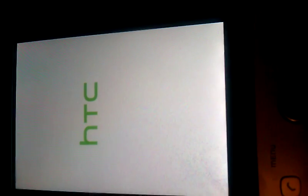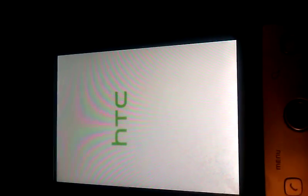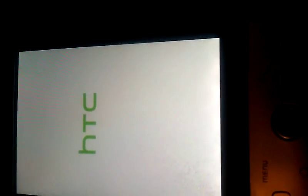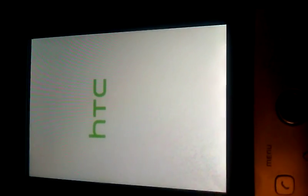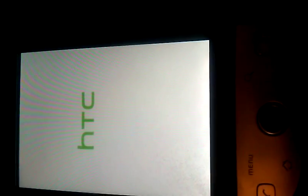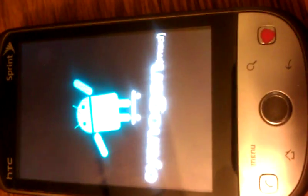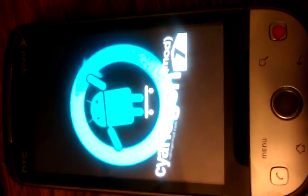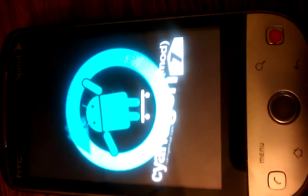Now it's going to reboot and go through a similar process, but this time it's going to flash the Google applications over to the new ROM, which was ridiculously quick in comparison to flashing the ROM. So overall this is a fairly quick process. Most people think it takes like 30, 40 minutes or an hour — we're going to have this done in about 10 minutes. Right now we're sitting at about 8 minutes and I'm almost done. This is with a pre-rooted phone, but with a Hero you can root it pretty quickly with a universal root — just Google 'universal root' and you'll find an APK to install and root your phone. You don't even need a permanent root, just a temporary root so you can flash the new ROM.